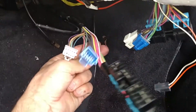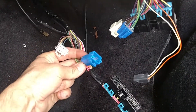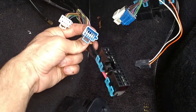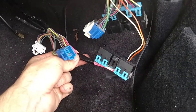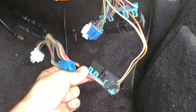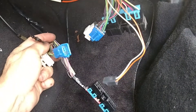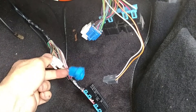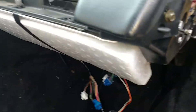All of that is basically to get to these three connectors here. This is where the engine harness comes inside the passenger compartment and goes inside this little kick panel area. Just take off the first, second, and third connector, and you're also going to have this vacuum line. Once you take these four items off, you'll be able to pull the harness through and get it out.